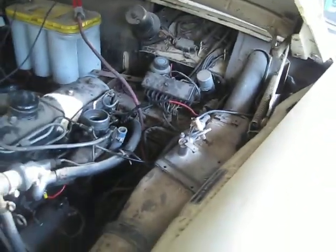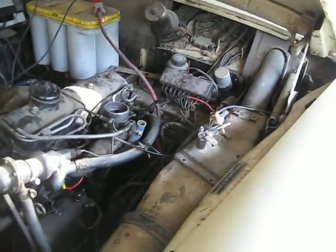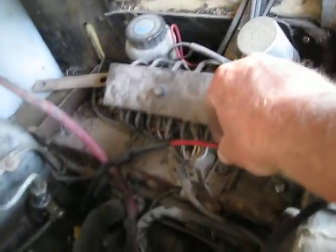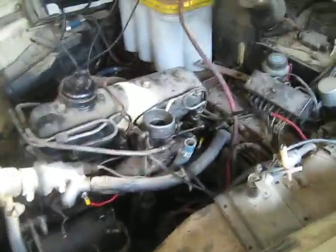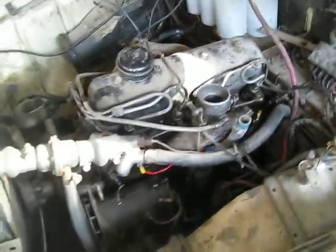It looks like a mini toaster. That's the ballast. Mercedes Source sells that one. So that's what the red 59 190 diesel needs, is a ballast. And then I use this thicker gauge wire. Otherwise, the thinner stuff's gonna heat up and melt, and then you're screwed. But it was a really big deal getting the fuel to here, because I didn't have that for a long time.